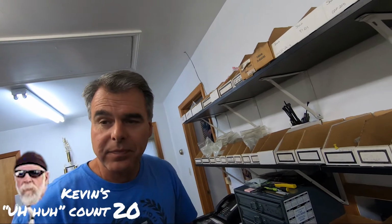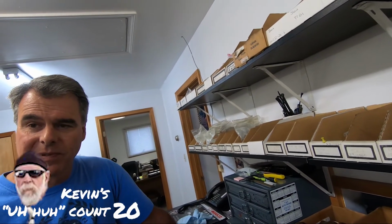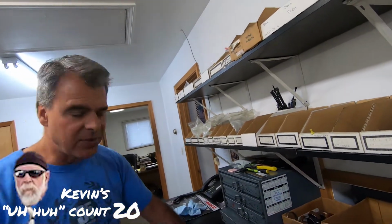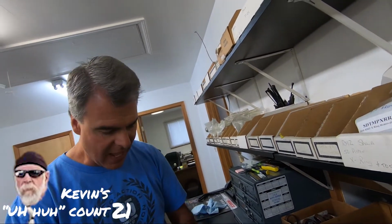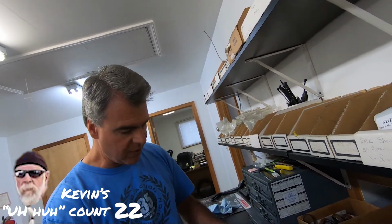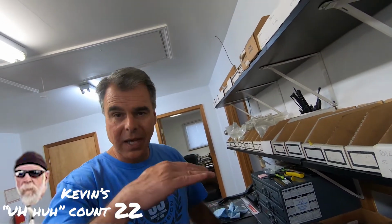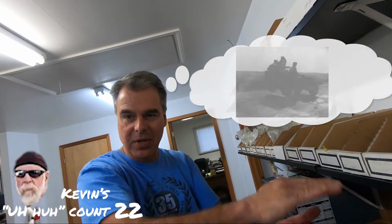Now, if you have too much sag, will it bypass one of these stages? If you have too much sag and you get too low in the stroke, a lot of times what will happen is, with not enough spring support, instead of the first stage picking up all the light stuff, it blows through this stage and immediately starts to be backed up by the second stage. So instead of a nice float, it'll drop down and then it won't bottom, it'll kind of catch and change directions on you.